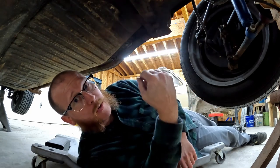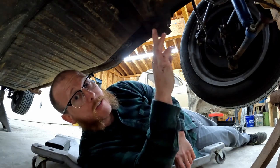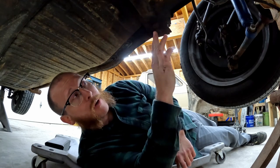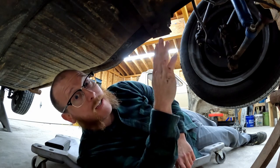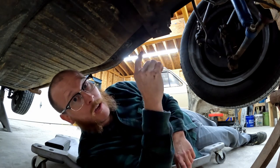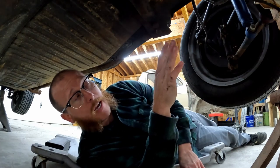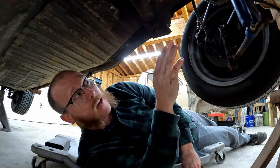A lot of times when you pull these bolts out, they'll be almost halfway rusted through. A lot of times these are really difficult to get out. So you don't want to just go reefing on these with your impact, they'll just break off. And if you break these off up in that firewall, it's a real hassle to repair. We've got to cut into the firewall, remove those old nut certs, weld it all back up together. It's just a lot of extra work that we can try to avoid if we're careful getting these out.